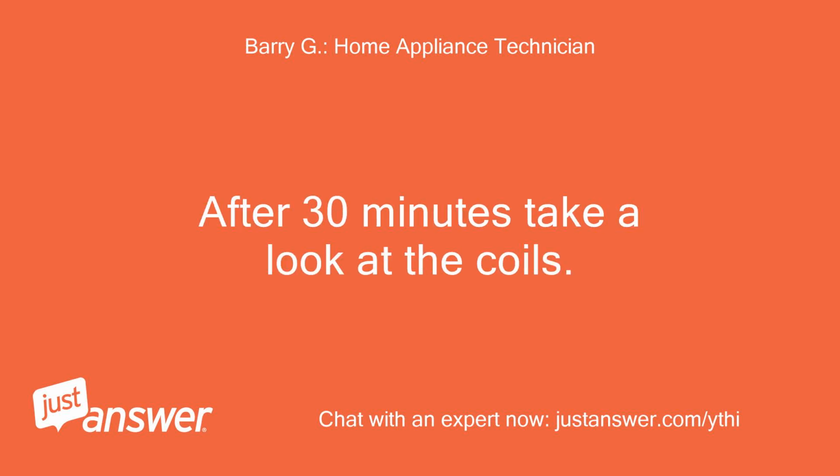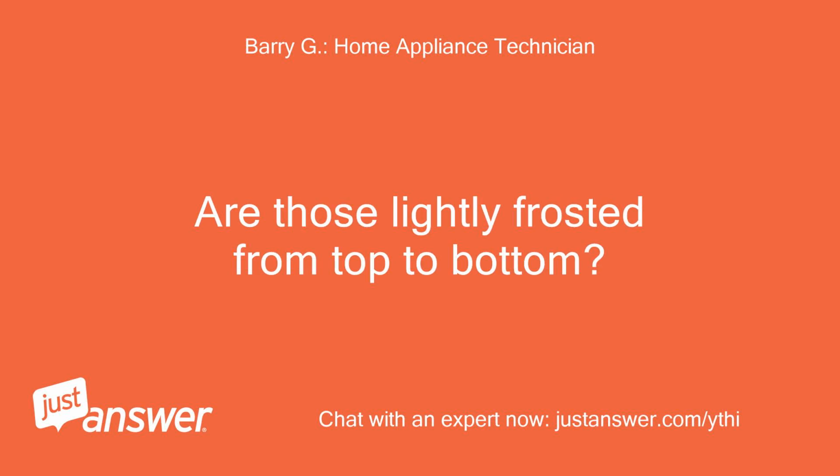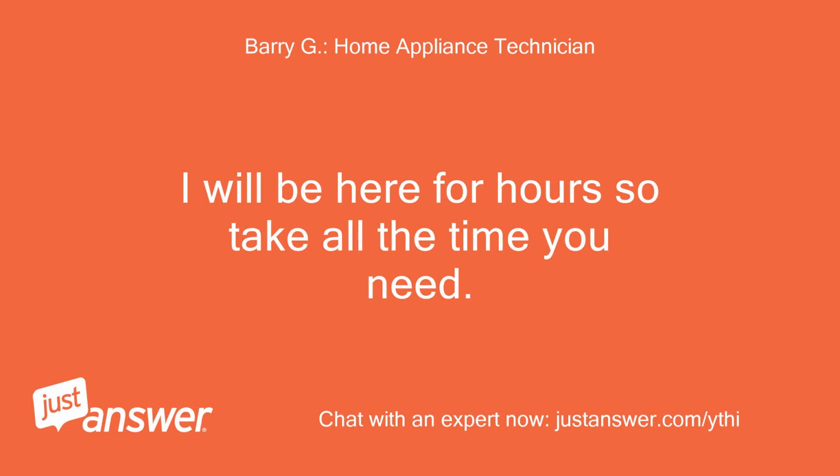After 30 minutes, take a look at the coils. Are those lightly frosted from top to bottom? I will be here for hours, so take all the time you need.